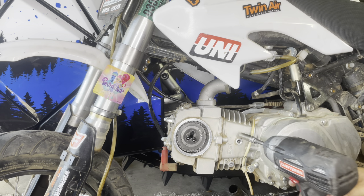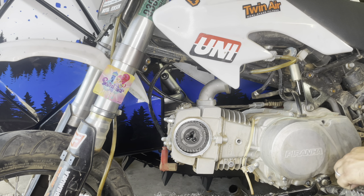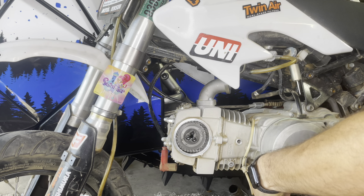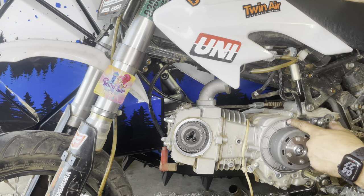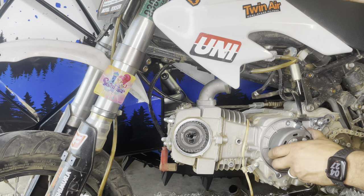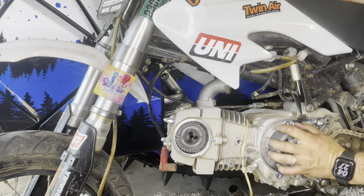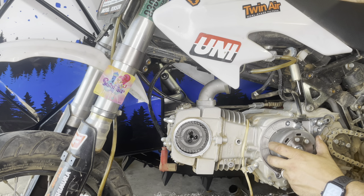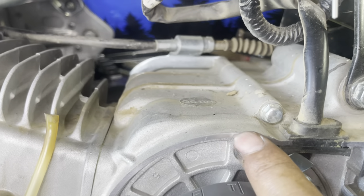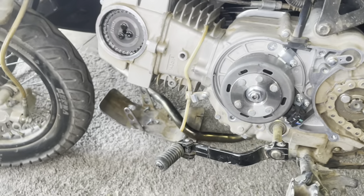That's for the little roller that's in there. Take the cover off and set the engine at top dead center. There's a little notch right there and this notch has to match right here. The 'T' right there is for timing or top dead center, and that little notch has to match right there - basically keep it right in that spot.